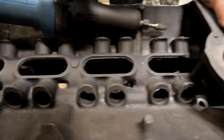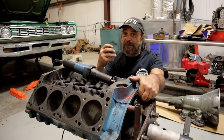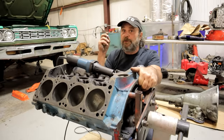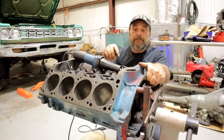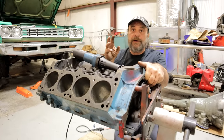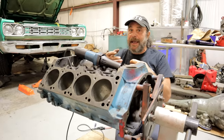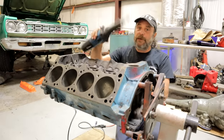This is important for a couple of reasons. Because it's flash, it's not structural. There's a good chance that when you really push this thing and it starts singing at six, seven thousand RPM, some loose parts of it will vibrate off. It's not an integral part of the casting — it's just kind of hanging on. So anything that's just hanging on, you want to knock down with a die grinder.